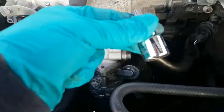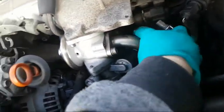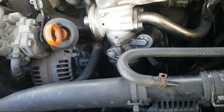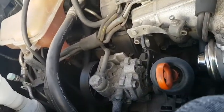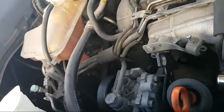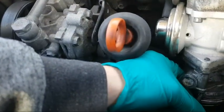You need a T50 for these ones — that one and that one. The other ones are a T30, which is there, and there, and there's a third one around the back where it's a really long bolt that goes through the throttle body as well — so it's round here. And it's a T30 for these as well for the throttle body, which is down there.